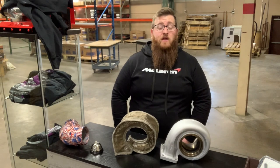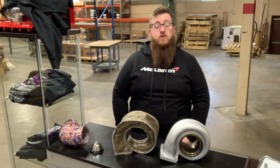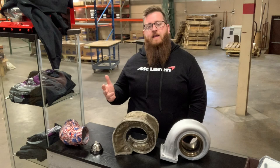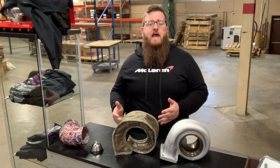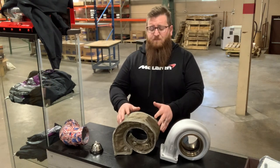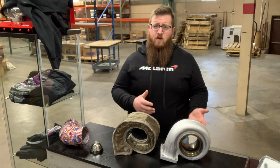All right, gang. So we're going to jump right into it. Normally, when you're talking about performance, you want things to run cool. Usually heat is your enemy. And even with exhaust gas temperatures, it's the same thing — you don't want a high exhaust gas temperature number. So you might ask yourself, why would I want a blanket or ceramic coating, something that's going to keep heat in? And here's the answer: keeping the heat in is not really affecting your exhaust gas temperature. It's just affecting what's going on afterwards.